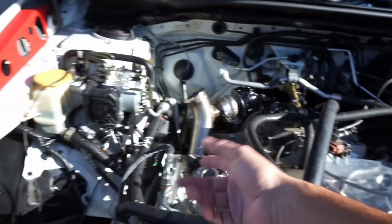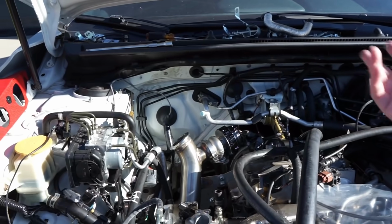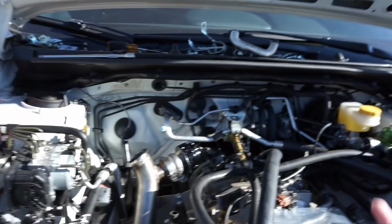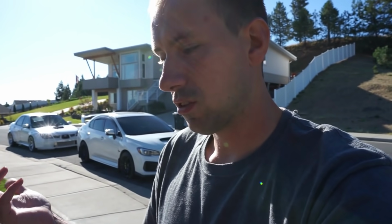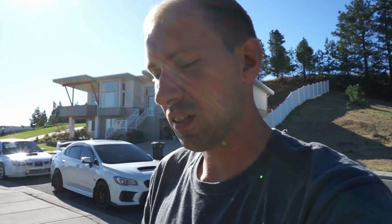Especially like on this car, I run 4 ports, as most of you know, so we can control the bottom and the top of the gate. Hyperblue does have a Grimspeed 3-port on it, running the top and bottom of the gate, and again, that's tuned by someone else. That's tuned by JR, and then we have, say, Gray Car is tuned by Steve, and Steve likes 4 ports, JR likes Grimspeed 3 ports. So that tells you guys, just check with the tuner and accommodate to what they want, and it'll make your life a lot easier, and I believe you'll get better results.